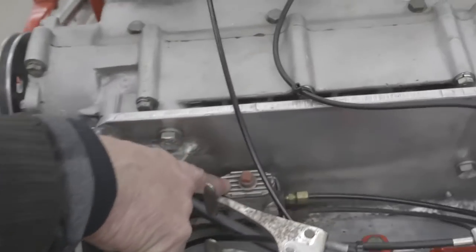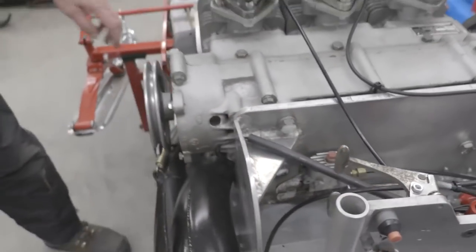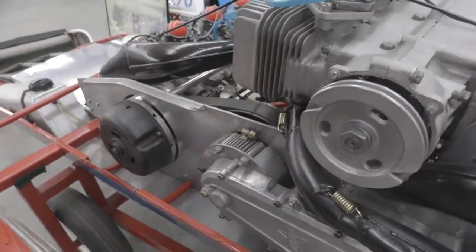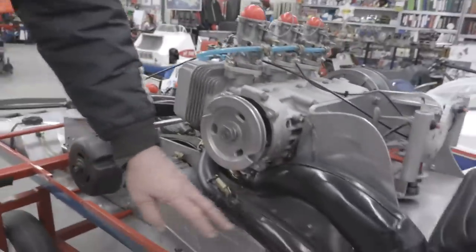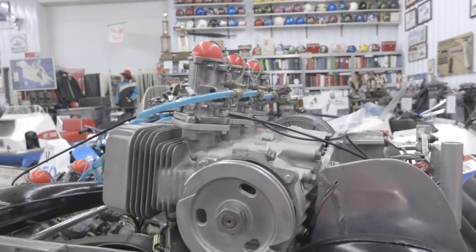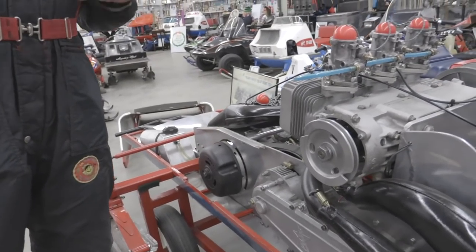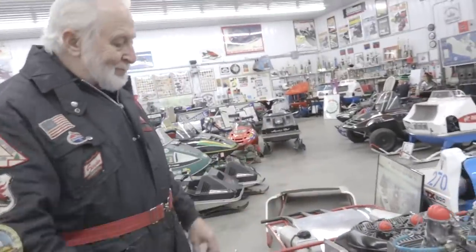This is a hydraulic master cylinder, off of like a go-kart. And it went down and it was on a disc brake in here, and that's how it worked in the chain case. And so you had two chain cases, one on each side, going to one drive shaft. And if one motor was making more power than the other, the drive clutches would offset that so it wouldn't bind up, like a four-wheel drive. And so there would be more give back and forth.